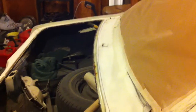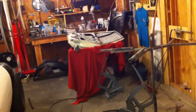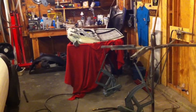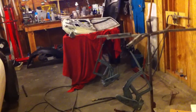My trunk seal — I don't like to take stuff off the car unless I've got a replacement, but I made an exception in this case so I could get everything that needs to be in primer, primed. Or sealer, I guess — I'm really using the epoxy as a sealer, not a primer. So anyway, that's my task.